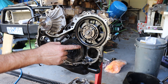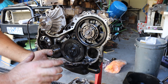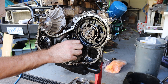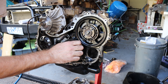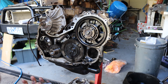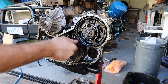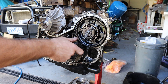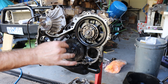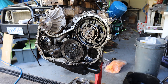This is the idle pulley and that's spring-loaded. There's actually three separate gears that are kind of spring-loaded together. Now, when you pull these gears off, you've got to make sure you put a bolt in that idle pulley, just like that. Otherwise it'll unspring and you've got to make a new tool to kind of cock it back together. So really important you don't forget that. And when you reassemble it, it gets in the way of the timing cover so there's no way you can forget to take it out either.